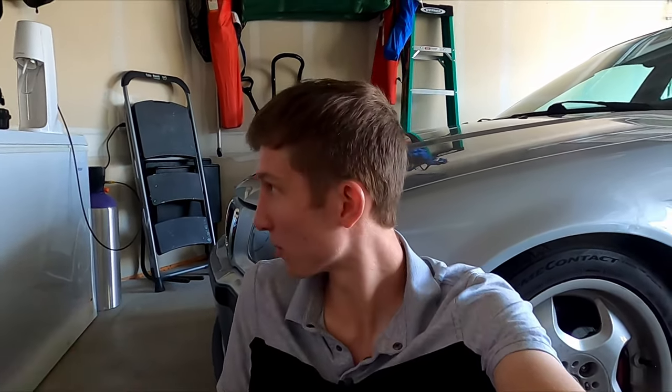The reason you're looking at that photo right now is because I finally had my car at a shop. I was able to get an appointment and they diagnosed a bad CCV. I did a CCV a bit over a year ago and it already clogged up. You can see in the photo, the thing is just covered in oil. If you're watching my Instagram, you would know why this happened. The parts are here and we're going to get it fixed. Hopefully once we get it fixed, the car is going to run a thousand times better and we can go rip it.